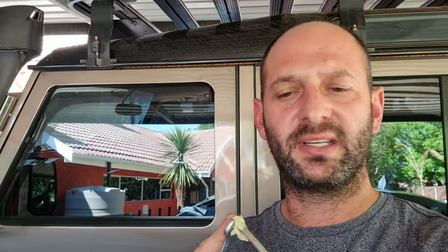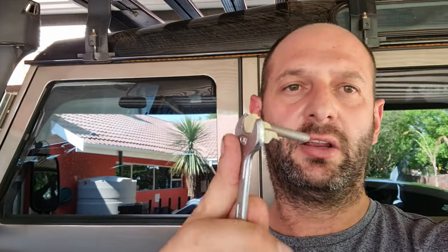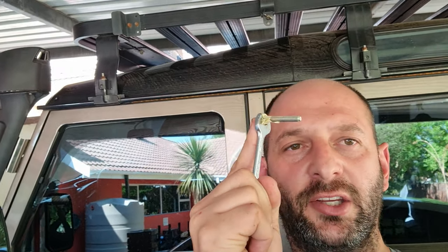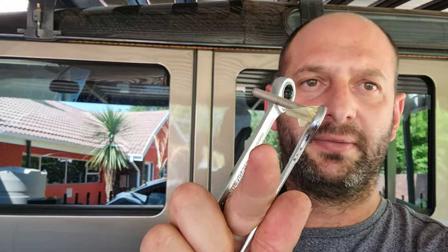So to put the bottom bolt on the master cylinder is quite difficult. There's not enough space. So what we did is we put masking tape around the point and used a flat side of a spanner. Using your finger like this, I managed to get up there and push it in from behind, and I used a buddy to just hold the spanner on the other side, put the nut on, and then after that I used a ratchet and tightened it from below. So that worked quite nice. Just to give you an idea, these ratchet spanners do work quite nice. It's a bit of a fiddly job. You need to turn it quite a lot before it actually tightens. Quite difficult to get in there, so using this method, it definitely helped a lot.